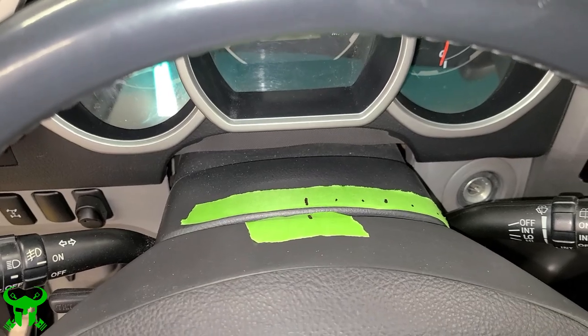That job's done. It took me most of the day, but it had never been completely shown online with all the steps and all the possibilities. I tried as many different things as I could — changing out the bolts, taking that collar up and down, adjusting it — and learned a lot about the system. I got to the point where I was changing that spline by one tooth back and forth, and up at the steering wheel it was moving a lot more. When you're driving and you put input into the steering wheel, you have to do a lot of changes to the wheel to get everything down here to move a little bit — that's the point of the steering ratio.